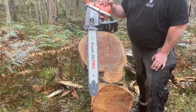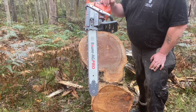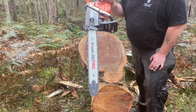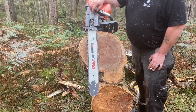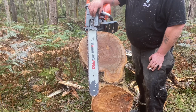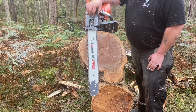So I did some research. There's a forum somewhere on the internet that mentions the clutch side seal. So I thought I'll take the clutch off and check the seal. I checked the flywheel side seal, it was good. Had a look at the other seal, it was a bit wet around there behind the clutch. Popped out easy with my tuning screwdriver.